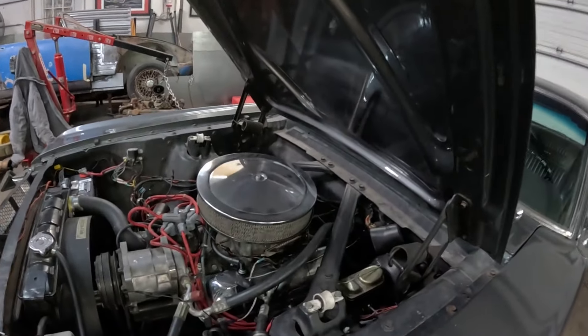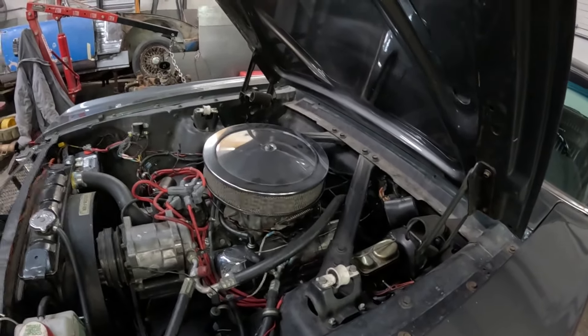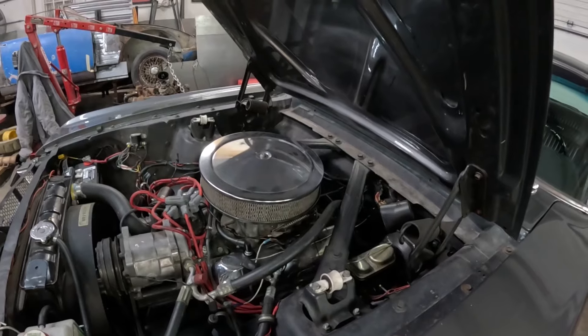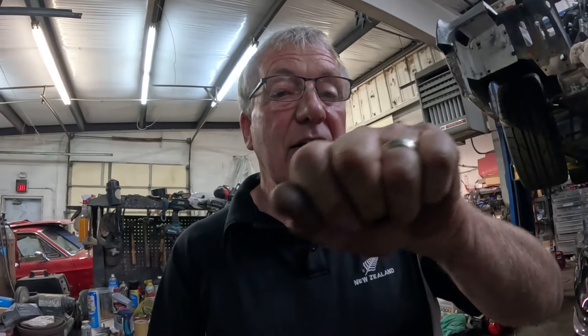There are some issues that need to be addressed, then we'll get it up on the rack. There's something vibrating the steering — someone's put a Flaming River rack and pinion in it, which I'm not a big fan of. Just driving it into the shop, you can feel the tight spots in the rack. What they've done is squeezed the rack into a location behind the front axle line where the normal steering box linkage goes — there's really not enough room for it. The angle coming off the column is too severe; a steering universal will only run to 30 degrees and typically these are a little over that.